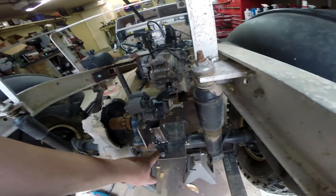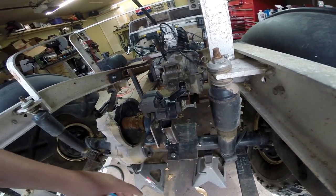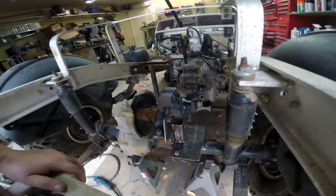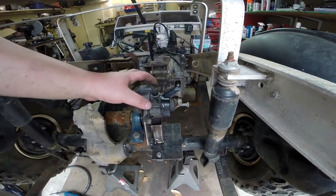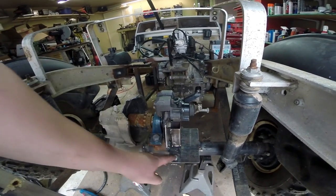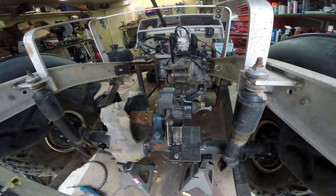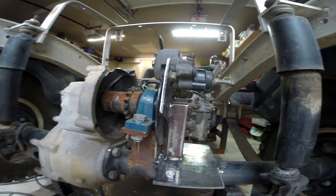We have this adapter bracket plate with a little piece of square tubing mounting it to a plate that is welded to the axle — much like when we built this — but this obviously unbolts. So when we need to take everything apart we can unbolt the caliper and remove it separately to service just the caliper, or unbolt the bracket and remove the whole caliper assembly so the drive assembly can slide out just like it did before. Super centered, pretty happy with the fitment.